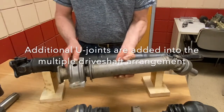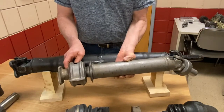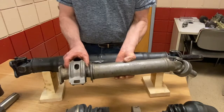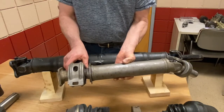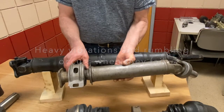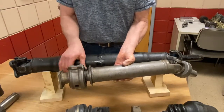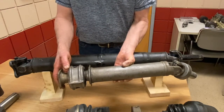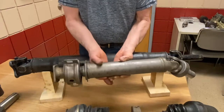These center bearings are pretty durable, but sometimes they fail at a certain mileage when the bearing life is at its end. The rubber breaks down, and they can start vibrating. If they seize up, it can cause heavy shuddering and shaking under the vehicle — it can even feel like a real wobble, but it's all coming from underneath where the center bearing is moving around. It can be quite alarming when it happens. So if you start hearing noise from under the center of the vehicle, it's time to look at the center bearing condition and also the universal joints.